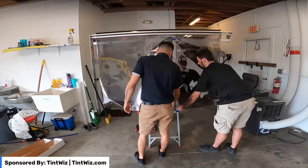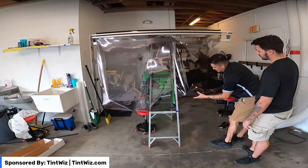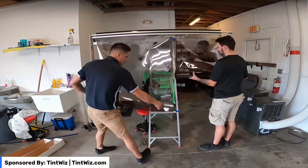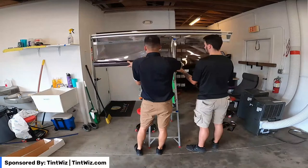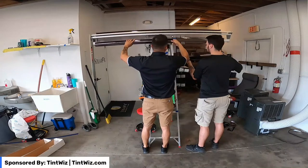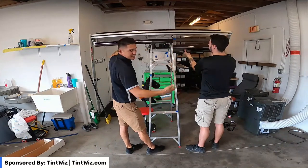Roll that one liner side out — liner side out will help protect the film. This is the side I'm using right here; this side is going to end up being spare film. Now we're halfway done. From here, what you're going to do is pull down the film again. This is your marker for your halfway point — you're going to pull this tape in line with that tape and that gives you your 90. Pull straight down.